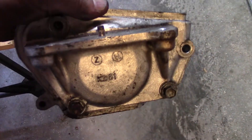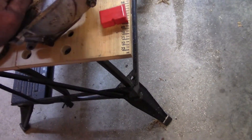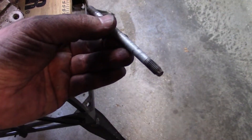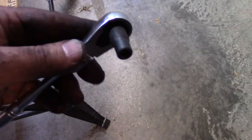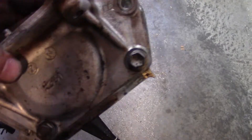I was able to get this plate out. I had an issue where it came out of the block and the nut was not coming loose. This bolt does not come out, so I didn't spend time taking that out. Thankfully I had the tool to take this bolt out — you can see the end of it is a little different. You need to use a special socket for that, I think an 8-millimeter. When you work on Toyotas, you definitely need to buy these special sockets. Once I got this bolt loose, I was able to get it out and it just came right out.